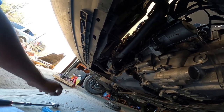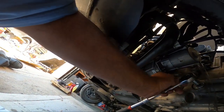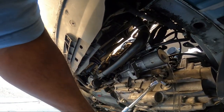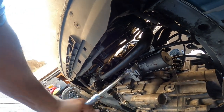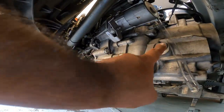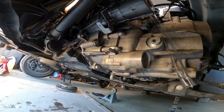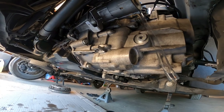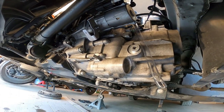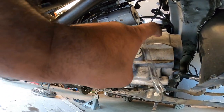All right, give this a good tug. I'll give you guys the torque specifications in just a moment. All right, so both fill and drain plugs are 18 foot-pounds torque to spec. Call it done. That's it, guys. Thanks for watching. But as a reminder, before I say goodbye, you're going to need to drain first, then fill.